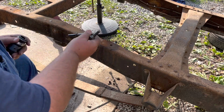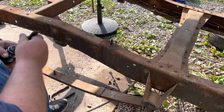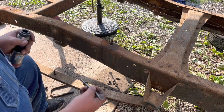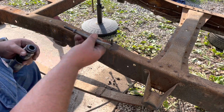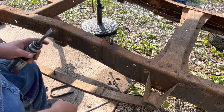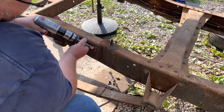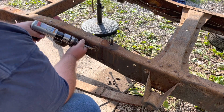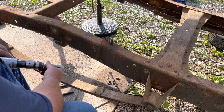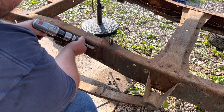I did find that the hole in the top of the frame for the bed mount makes the perfect place to put the punch. And earlier on the time-lapse video, I don't know how much you'll get to see, but I couldn't get the rivets to come off, and it's because I didn't have the chisel bit all the way into the hammer, so it makes it work a lot better if it actually hits the hammer. So if you hit it at about a 45. And the other thing is, I do highly recommend some earplugs or some hearing protection on these. That frame rings and it is pretty loud.